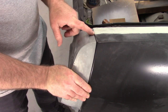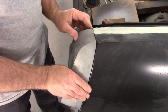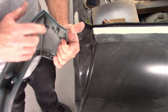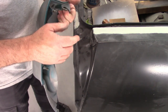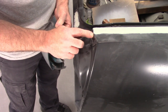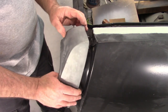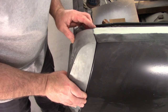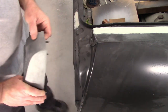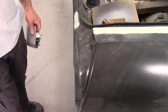When you're doing this, look for the point of contact and see where it rotates back and forth on that point of contact, like a seesaw. So you gotta find that and then try to eliminate that. And sometimes when it's doing that contact, you see what I call a witness mark. It's kind of chafing and it'll put a little dull finish, or maybe knock enough paint off to where it's shiny, and that lets you know where the high spot is. So that's again pretty close and probably enough that I can live with. And anyway, just some information for you.